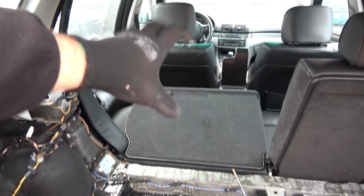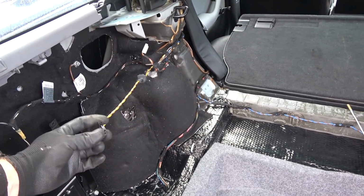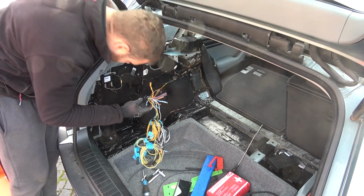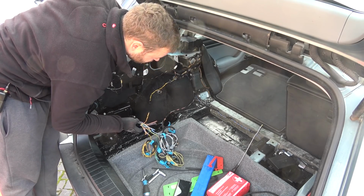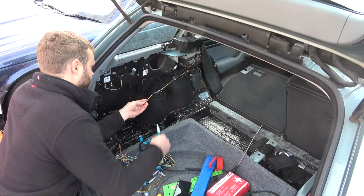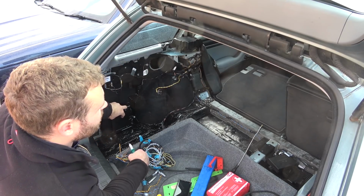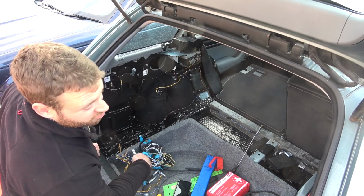And then do kind of a switcheroo over there, so I don't have to run the wiring all over the car, and just, they're not gonna be the same color as in the diagrams, but it'll work. So this here is the connector for the amplifier and where all of the speakers come. And now I'm going to, because I chopped it up from the donor car in order to remove it, connect these speakers in the back real quickly. Snip this one here. And then these 2 cables I'm probably going to reuse from the radio and run it to the amplifier. Then I don't have to run the wiring through the middle of the car. See, that's a genius idea.